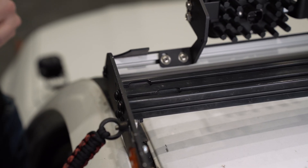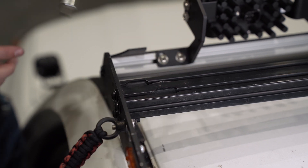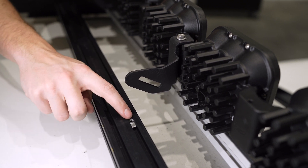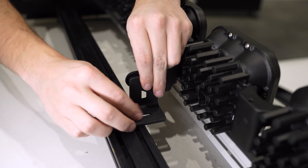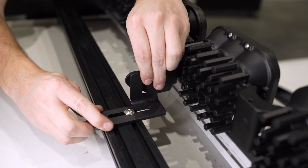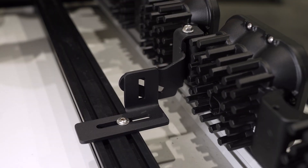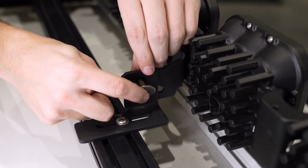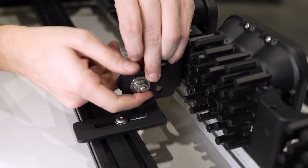Next, locate the support crossbar behind the SS5 crosslink and slide the single T-nut into the top forward channel. Sherpa roof racks do require partial disassembly to slide the T-nut into place. Attach the support bracket to the single T-nut using the included screw. It's important to note the flange section should be facing forward as shown. Now, we can slide the support bracket along the crossbar and align it with the SS5 link mount bracket. The support bracket should be on the right-hand side of the link mount. Loosely secure the support bracket to the link mount using the included M8 bolt, washer, and nut, leaving them hand tight for adjustment later.